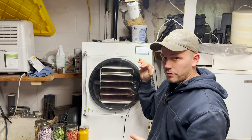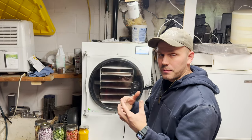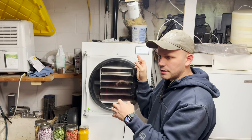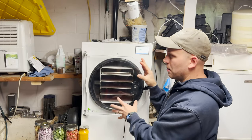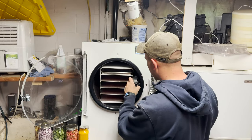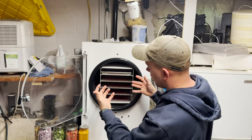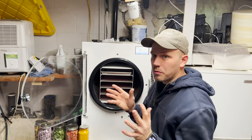I usually only run it for about five, maybe ten minutes — that's enough to warm everything up and let the ice let loose from the side. Then I cancel the defrost and let it sit for another five to ten minutes, because that cools down all the heating elements again so it's ready for the next load. It's even cooler and takes less time. Then I pull out the whole tray with all the ice, discard it, wipe everything down, and I'm ready to roll.